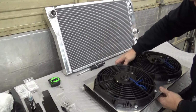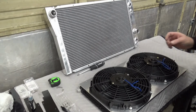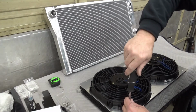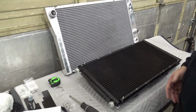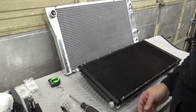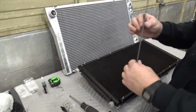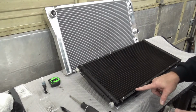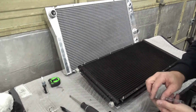Now on the top side, to aid in the mounting to a strip to mount to the radiator core support, I'm going to use some long screws all the way through that will kind of serve a dual function. Alright, I kind of pre-fit things and came up with some mountings, some little spacer brackets to mount to the core support. You'll have to cut those out. These are out of 1/8 inch thick aluminum. I just painted them black real quick, and we've got rivet nuts here that they'll screw into, but we have now the stud coming from the other side, and I want to drop a washer on here just to keep the spacing the same.